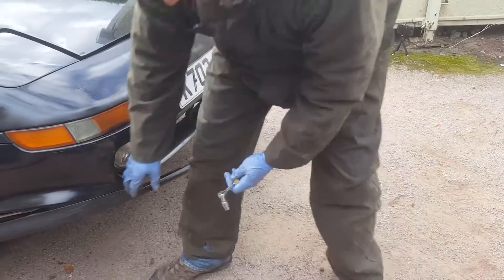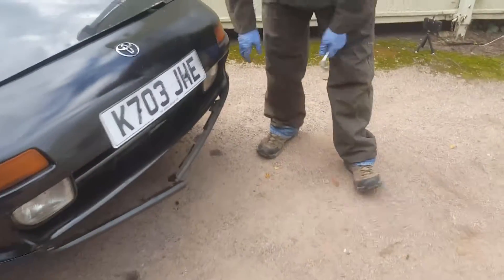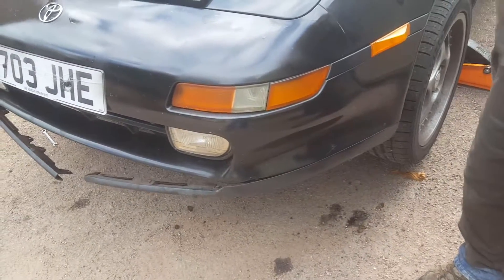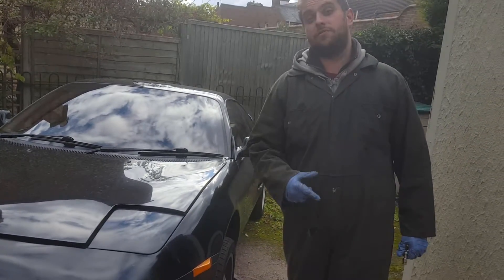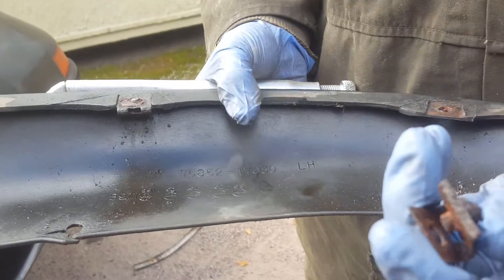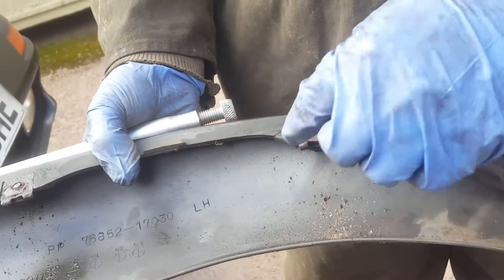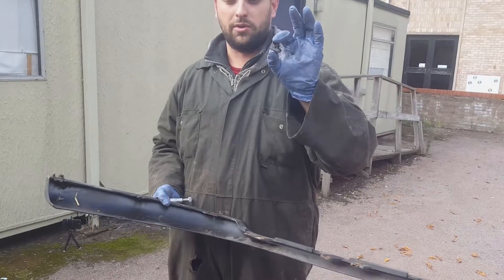As you can see, this side is free, this side is free, but that one in the middle — the bolt is all rounded off. And we have the same thing on this side where two bolts also want to go in and are rounded off. We finally managed to get it off, and you can see where these bolts were — they just didn't want to come out, they were too rusted. The problem we've got is the captive nut is part of that clip, so that sits over there and the bolt comes through the top into that hole. We'll take a quick break and grab a pack of these so we can refit the new lip to the bumper.